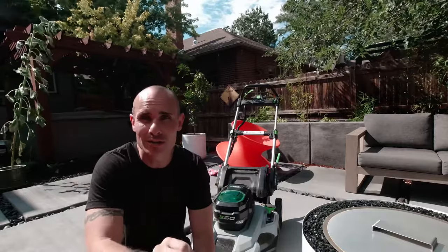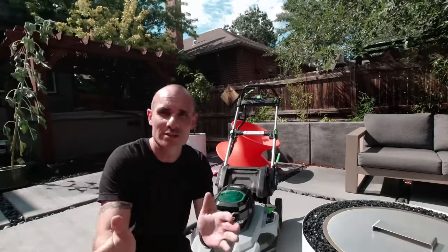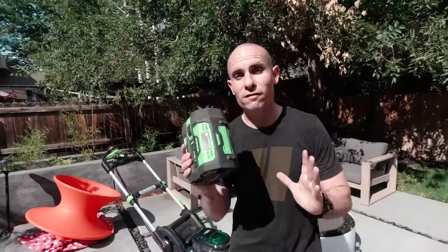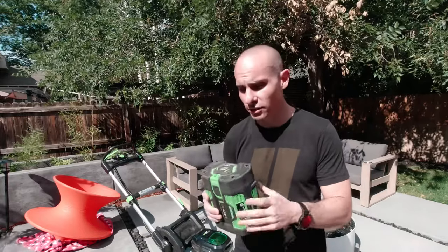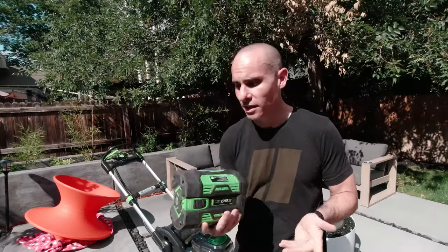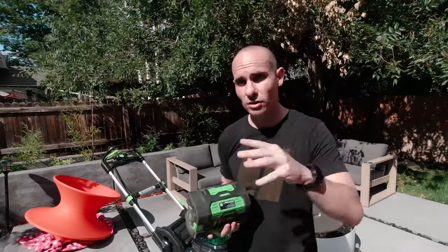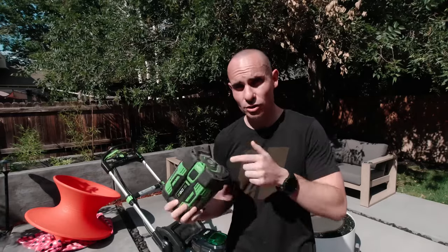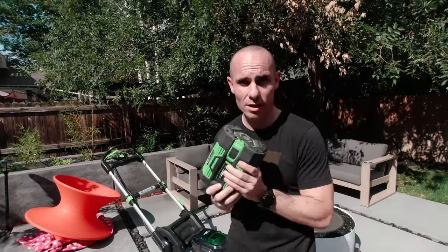Here's the troubleshooting process I went through. I'm going to explain the steps I took, the ultimate resolution, and what I figured out was wrong. The first and most obvious place to start is with the battery. You want to check two things: make sure your battery is charged and also make sure it's completely seated in the mower properly. In my case, I have two batteries, so I tried them both to rule that out. My newer battery also has a button on top that shows you the charge level, so you can rule a dead battery out.